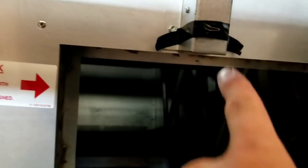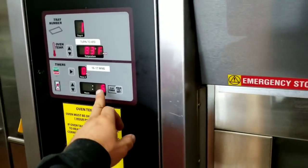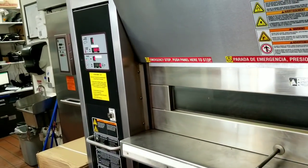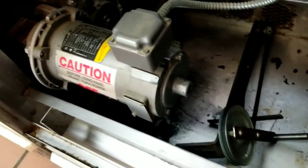Alright guys, I'm out of the oven. We're going to fire it up with the door open. To do so you have to bypass this little micro switch — it's a lever that closes when the door is shut. Just jam a piece of cardboard in there and put some tape on it and you're good to go. We fired it up and there's a six-minute delay as it goes through checks — all the probes, pressure sensors, safety systems. We're gonna stand here for about six minutes, watch it, and keep an eye on that oil stain down there. Hopefully the motor's not going bad.